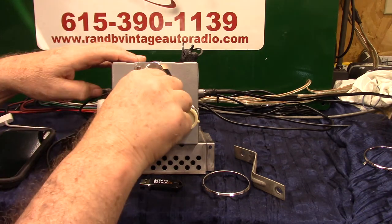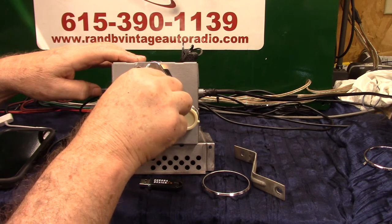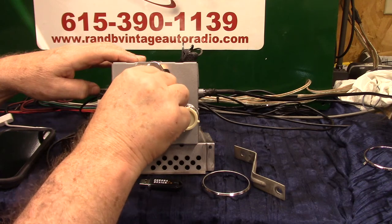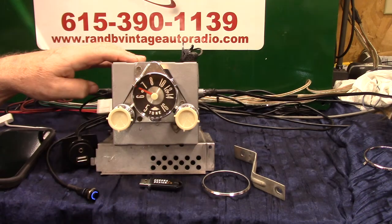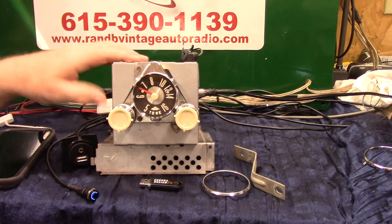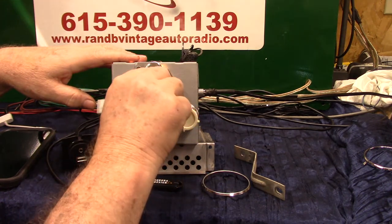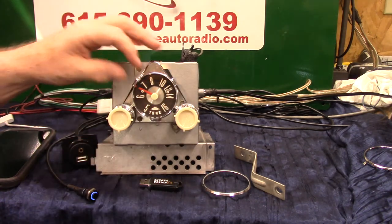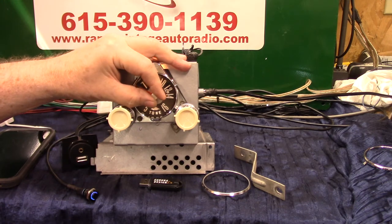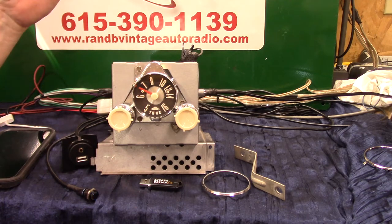Let's go to fader and go to our back speakers by pushing it once and holding it. Fader adjust. Go to your tone control. There are your front speakers, there are your back speakers. That little pop you're hearing is the center of that pot — you want to balance them out where both are equal. Just find that little detent and stop moving and she'll set it for you. Fader set. You can also do it with the control knob — clockwise one, two. Fader adjust. Rears, fronts. Stop moving and she'll set it. Fader set.